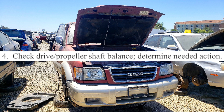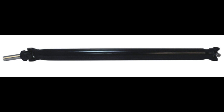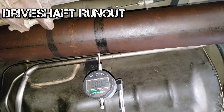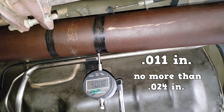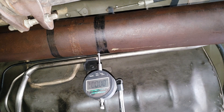We're going to skip number 4 — this is work for a specialty shop. Number 5: measure drive shaft runout. The general procedure is to check runout at 3 places — at the center and about 3 inches from each end. Clean the test area before you begin with a wire brush. At the center, we are seeing about 11 thousandths of an inch. The specification is no more than 24 thousandths of an inch. The other two measurements were within specification.